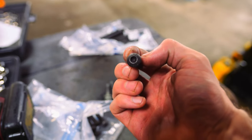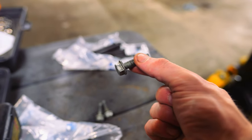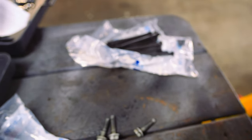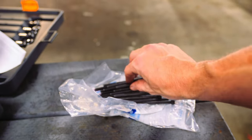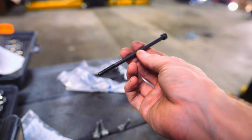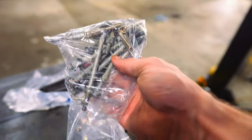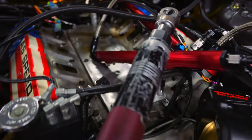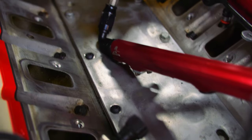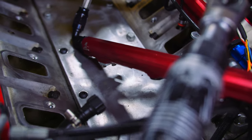With the FAST manifold, you need these allen button-head screws as the standard ones protrude too much and prevent the intake manifold from seating properly. We also had to switch to 110mm bolts instead of the 114mm bolts that come with the LS3 stock intake manifold. As you can see we're already underway changing those bolts out one by one, keeping this valley cover still properly sealed. Fresh new hardware — always a good thing.